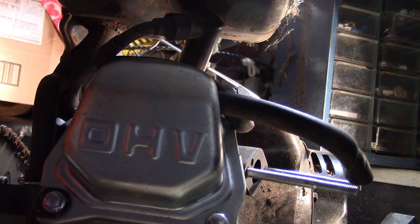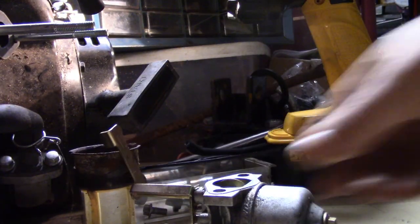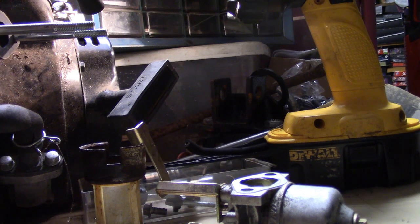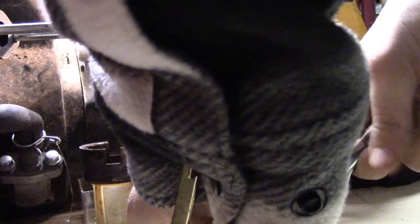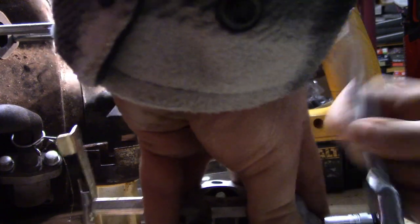Now we deal with the fuel situation and take this carburetor apart. Luckily, carburetors like this are very simple. If you don't know how to rebuild a carburetor, I recommend starting with one of these — they're very simple and easy to rebuild. You actually don't even have to replace the gaskets 90% of the time because they just don't go bad. Small engines are a very easy way to get into tinkering. You can basically do an entire job with a quarter-inch ratchet, except for the spark plug, which I had to use an impact on. This actually has a fuel adjuster screw.